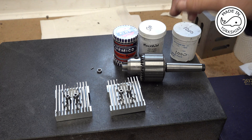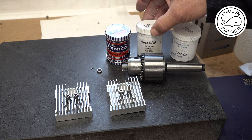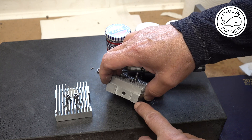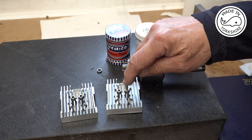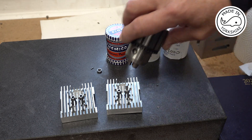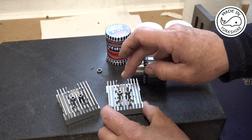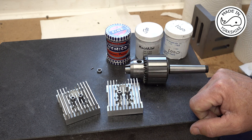To lap the valves I'm going to use some fine grinding paste, and I'll probably then go on and use 500, and maybe a thousand — we'll have to see how it goes. I've labelled up the heads: there's a little R for right and a little L for left. I know which is exhaust and which is inlet. I've got this chuck here which will go onto the valve to enable me to lap it, and once I've lapped them I'll label up each valve so I know which valve goes into which guide.